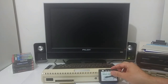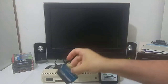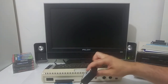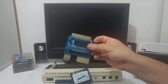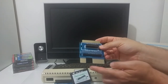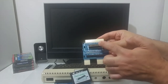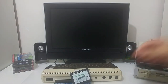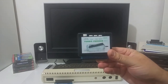If you have an Atari XL you need to use the XL extension — it plugs on the back of the computer and the Turbo Freezer goes on top. If you have an Atari XE machine there is also an XE extension that plugs on the back of the Atari XE cartridge port and ECI port. Because you are using the cartridge port there is an extra cartridge slot where you can still use your cartridge. The Turbo Freezer is an external upgrade and does not require any soldering.